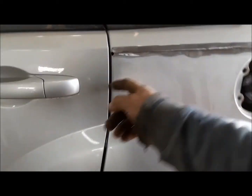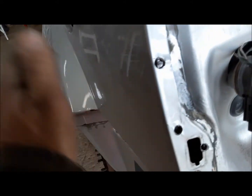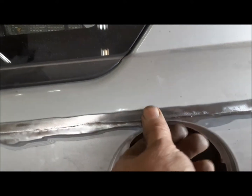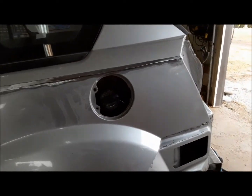That's pretty good - we've got a good door gap. Let's see how it fits at the back. Yeah, it fits right where it's supposed to at the back. The only thing I've got to do is there's some sealer and stuff - I've got to get all that crap up in there cleaned out, and there may be a little bit of a burr on the back of this panel because this joint is not sitting nicely like I would like to see. But it's certainly promising.